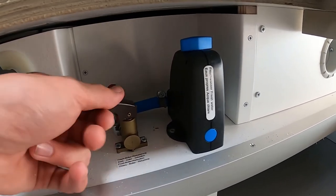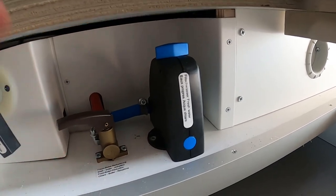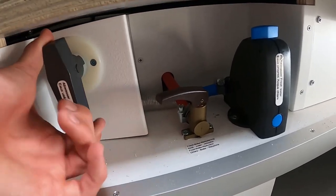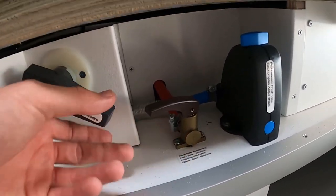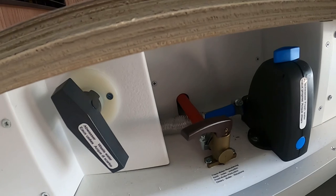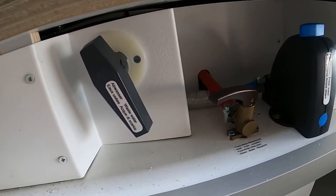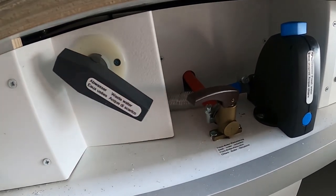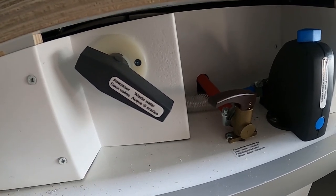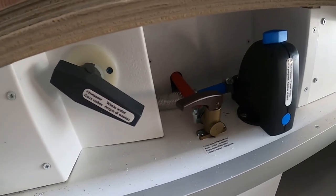This one is your hot water drain — lift this up and any hot water in the system will drain directly underneath the chassis. Then empty your waste water — it's in here and there'll be a pipe outside where you can connect an extension hose. Normally you drive over a grid, open this up and deposit your waste water — any water that's gone down the plug hole, so dishes water and soapy water. You can also open the travel drain on your fresh tank and this will drain all your water out.